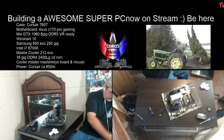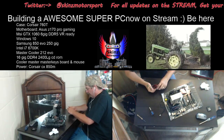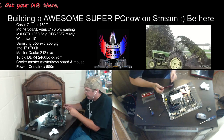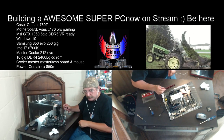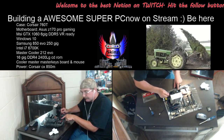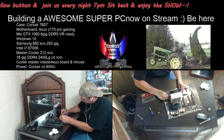So, here is our Ballistix DDR4. And these can only be installed one direction, because there's a slot in the memory card that coincides with the motherboard. So you want to open your tabs, insert it in the rear part of the slot, pushing it downward on the clip.